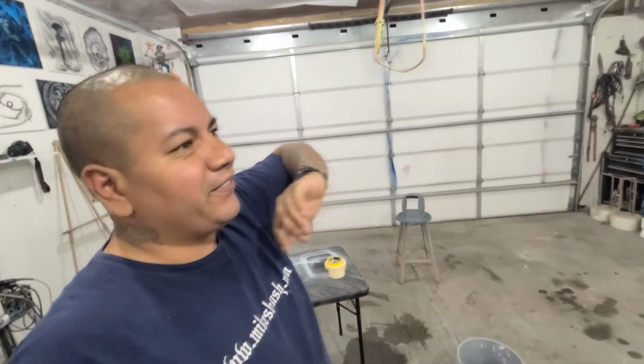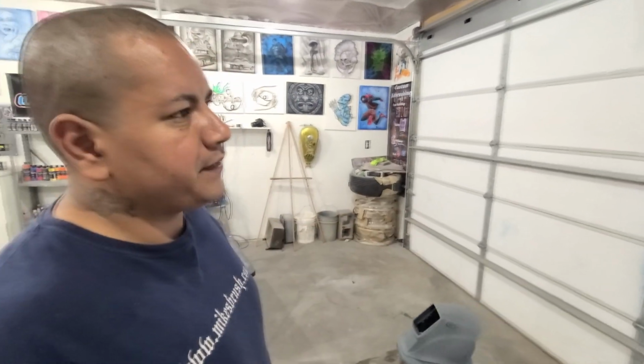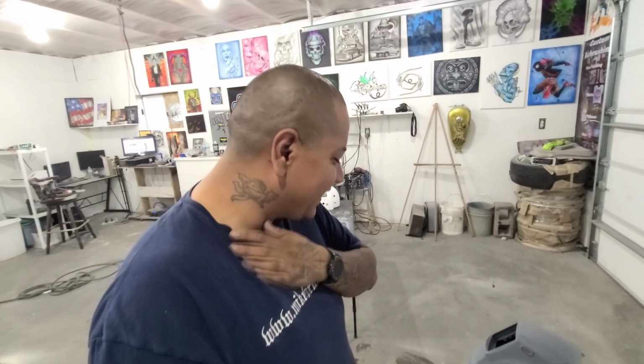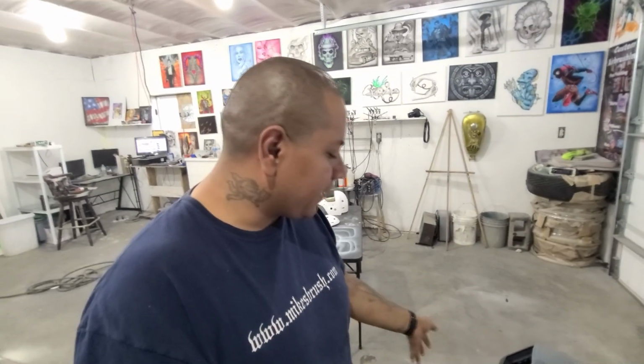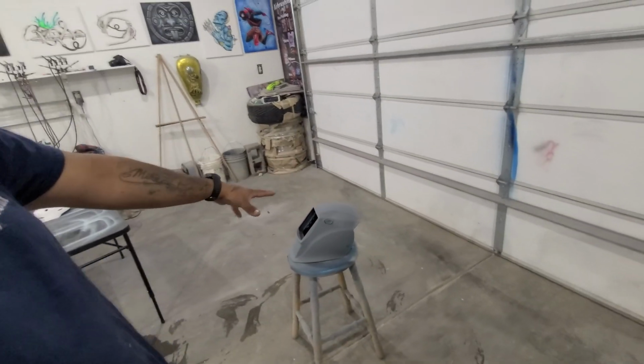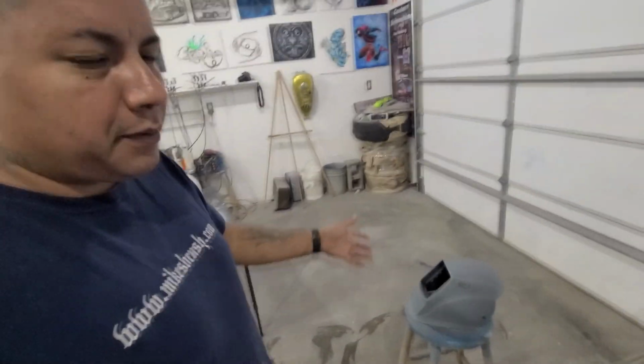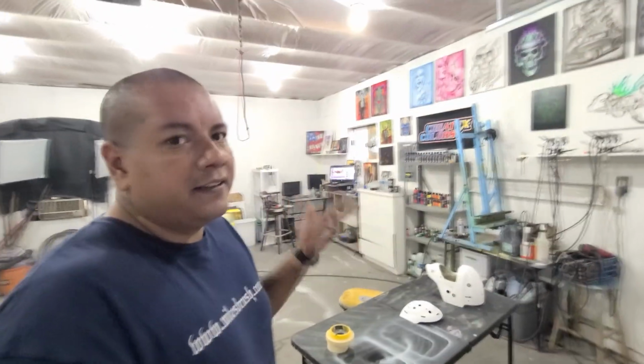We're going to lay a nice mantle over it, right? And then we're going to do the spray through. Oh man, I can't think of the name of what the design is called. It's like a mantle filled with filigree, a lace design inside of the taping. We're going to throw some black edging around it, and then we're just going to spray candy over it. Not too crazy. That's what I consider something pretty basic: just taping it, spraying some silver, throw some tape, some candies, good to go.